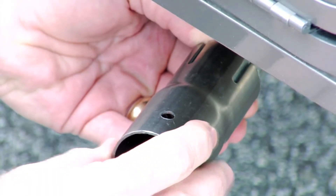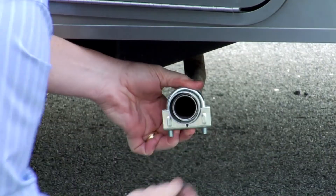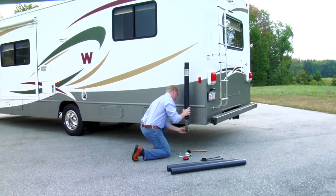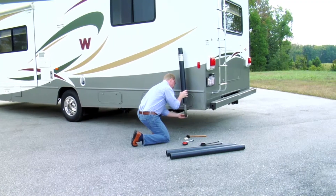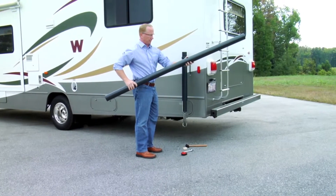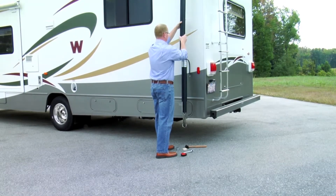Turn the mounting adapter to locate the holes vertically. Position the exhaust clamp over the slots on the slotted end of the mounting adapter and tighten. Mount the elbow and lower section of tube into the mounting adapter using the included lock pin. Be sure that the assembly is snug to prevent exhaust gas leaks during operation. Slide the upper and middle tube sections together, then slide these sections onto the lower section mounted on the RV.